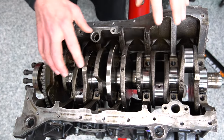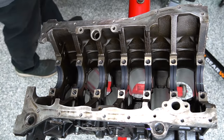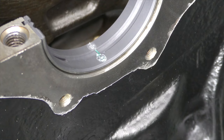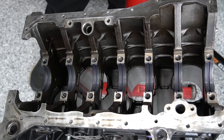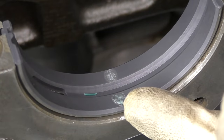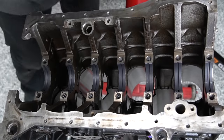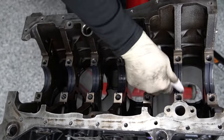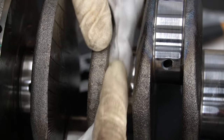Everybody looks pretty happy on our crankshaft. That was the bottom oil clearance since the engine is upside down. Next, lift the crankshaft out and check what our bearings look like underneath — we're pretty close to just over the 0.025mm mark. You can also check it on the crankshaft side, though it gives a slightly weird reading because of the gap in the middle. Now that we know our oil clearances are good, we can get the engine prepped for actual crankshaft installation. I like to use a little bit of Marvel Mystery Oil on our lint-free rag to clean off the Plasti-Gage residue, and this gives us another opportunity to clean the crankshaft and main bearings one more time.